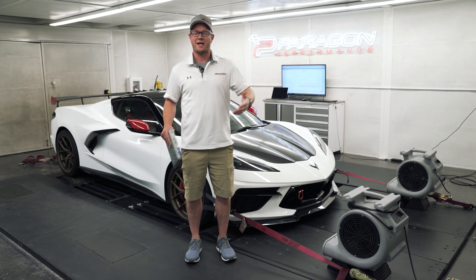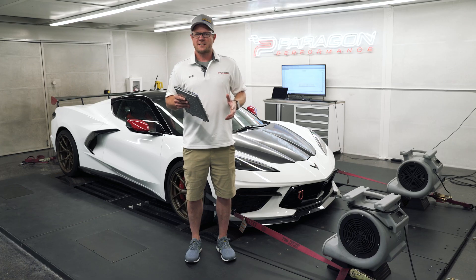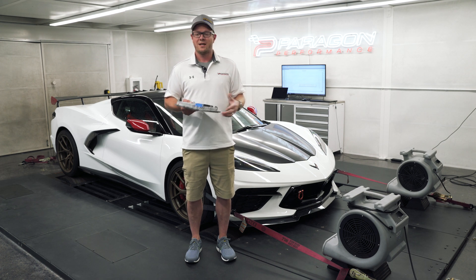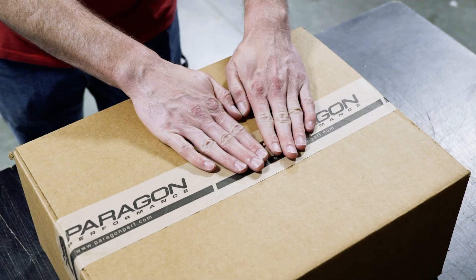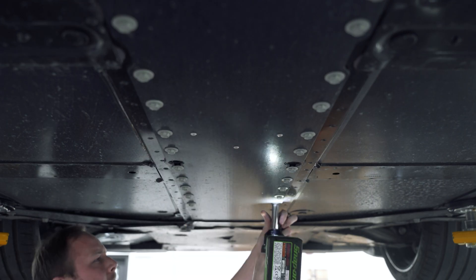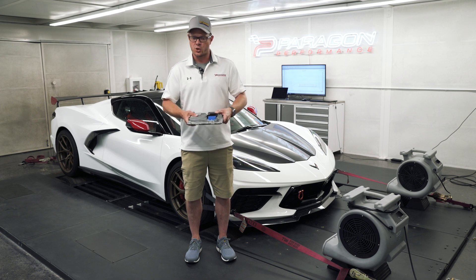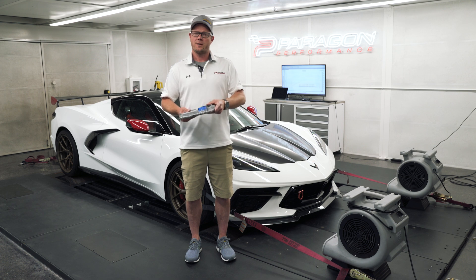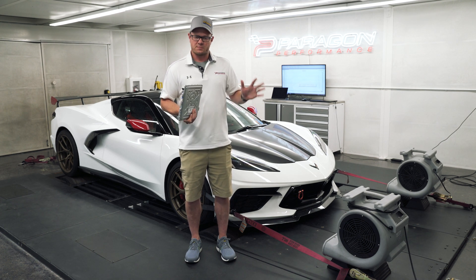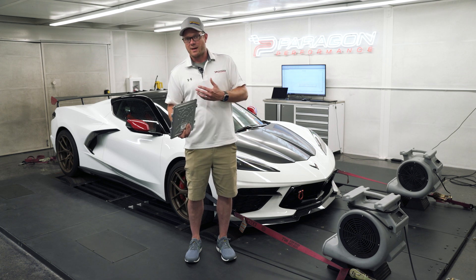Tuning is here — what does that mean for you and how do you get started? The ECM has to come out of the car and be unlocked by HP Tuners. Only authorized HP Tuners dealers can request that service and tune the cars. You can bring the car to us, we remove the ECM, ship it to HP Tuners, get it back, and tune the car. Or you can request the service through us, remove the ECM yourself, send it to HP Tuners, get it back, reinstall it, and drive to us. The car comes back with the stock tune — it's just unlocked and ready to tune. The tuning process must be done in person by an authorized dealer, because after each flash there is a special procedure and special tools needed to synchronize all the modules in the car so everything communicates and the car is drivable. If that isn't done right, the car might get stuck and not be able to drive.